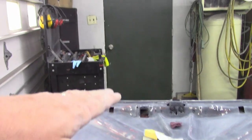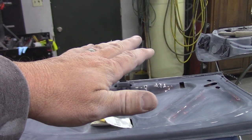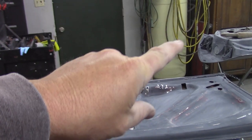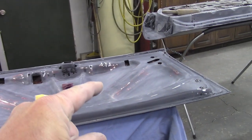The tech sheet recommends 500 to 800 for this paint. When I do the exterior, I'm certainly going to take it probably to the 500 area. We'll see. I may do 400 with the gray Scotch-Brite, which is, you know, even finer than 400 grit sandpaper. So that's what I'm doing.